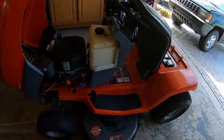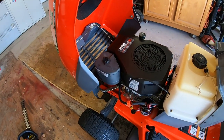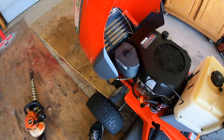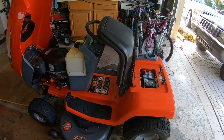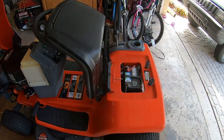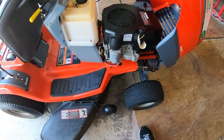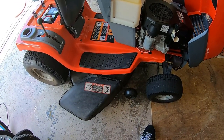So far all we've really done is cleaned it up with some Simple Green and a garden hose, changed the oil, got a new filter from Lowe's, put some 10W30 in, blew out the air filter — have a new one on order — and ordered some new belts, because the belts on this mower are completely trashed with sections missing. No need to adjust the valves since this engine has hydraulic valve lifters. Some of the safety equipment needs adjustment — it's a pain to start, and you can't get up while it's running even if it's not in gear and the blades aren't running. We'll probably have to replace some tires; that front one has a hole that leaks.